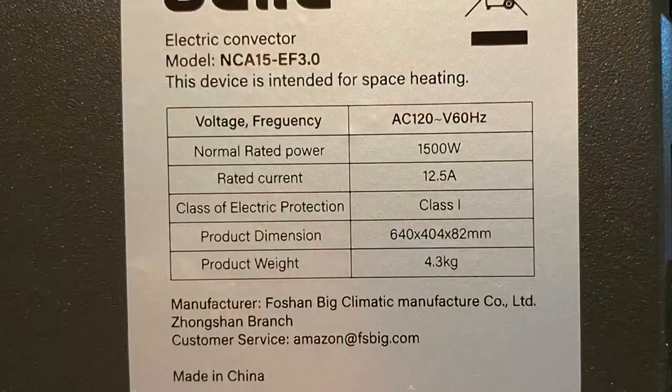At 1500 watts this pulls 12 and a half amps; at 750 watts it pulls about 6 and a quarter amps — but that's at 120 volts. If you're running lower, say 110 volts, it's going to pull a little over an amp more. This is a serious load and the plug is going to get warm. If it doesn't fit tightly into a receptacle, that receptacle needs to be replaced — a loose connection equals resistance, that equals heat, and that equals fire. I like this and I'm giving it five stars, but only for people who respect the dangerous potential that space heaters have.